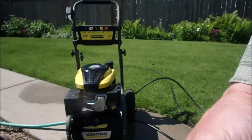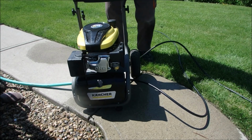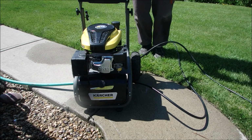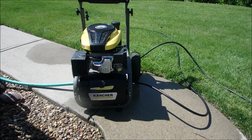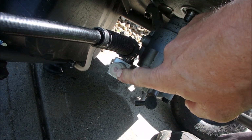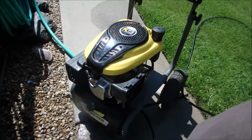I might just turn the governor up just a tiny bit, eh? Because it's really working hard, or I could turn the pump volume down. That's probably easier on the motor. Where's the adjustments for that? Right there underneath that cap. Anyway, it's a win. Thanks for watching this. If I turn the cap down, all you need is an Allen wrench and a 10 millimeter screw, and you just get in there and hold one and turn the other one down and then tighten the other one back up again right there. So I got to think about that. I need a drink of water, and we are there.